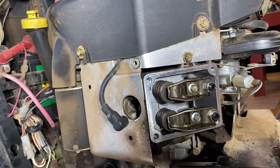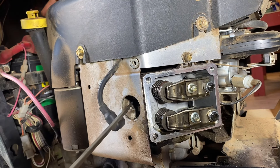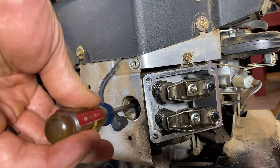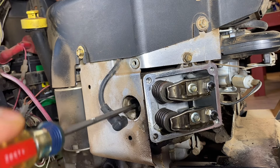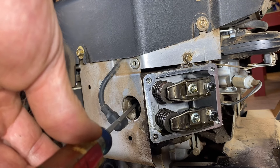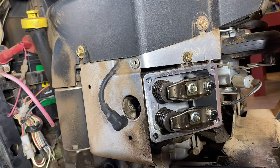So now what we want to do is adjust the valves when they're at top dead center, meaning that piston is at the very top of the compression stroke, pushed all the way out. Keep it clean and then just slide it in the spark plug hole. Then you're going to twist the crankshaft — essentially twist the fan on top of the motor — and you want to feel where that piston pushes all the way out, to where your screwdriver is pushed out as far as it'll go. When it is, you'll feel it start sliding back down. So this is as far as it goes.